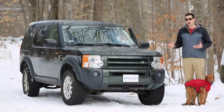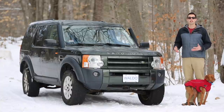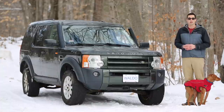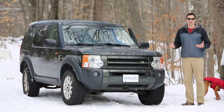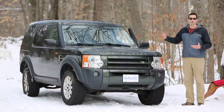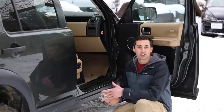Now this vehicle is almost roadworthy, and the task for today is to fix the brakes. The brake light is illuminated on the dash in red, the brake pedal itself feels rather spongy, and the brake fluid reservoir is mostly empty. And that means, unless the brake fluid elves came along and removed all the brake fluid, that there's probably a leak somewhere. Now back to the air suspension real quick.